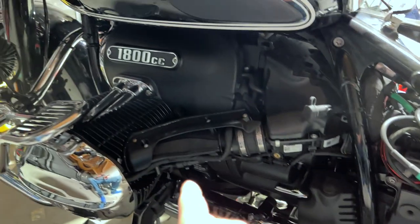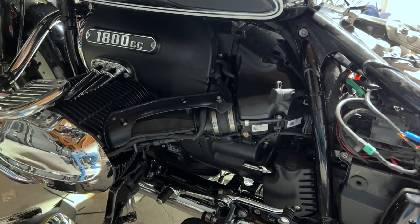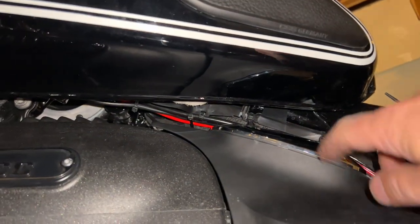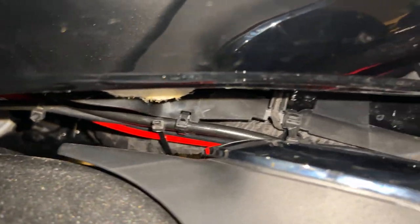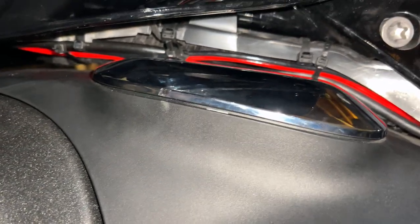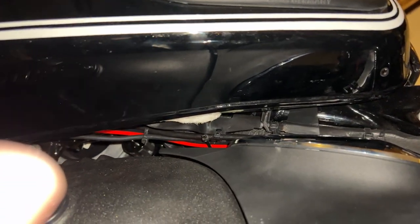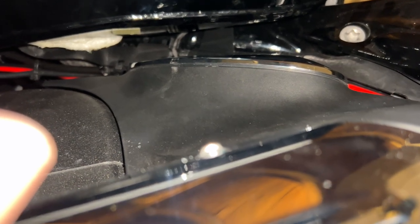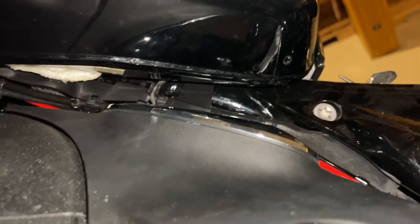From there, add the seat back, then the top case, then the side luggage, and we're done. That'll take about an hour. I'm going to take my time and make sure everything here is all tucked away — remember that shock is right there, so you don't want anything up against it. Do some zip ties down here, then get the battery cover back on. To get it back on there are three clips, and I had to redo the zip ties here to make this cable sit a wee bit higher because it was preventing the left side from fully closing. The cables were just a little bit low and pinching when trying to close it back up. If you install the wires without removing this cover it'll be tough — better to keep them really high and tight so you can get it closed back up with no problem.